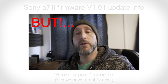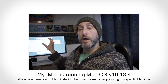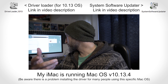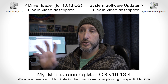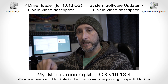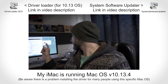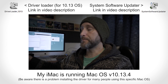A couple of things you should know if you're running a Mac like I am — I'm running the latest version of High Sierra. First of all, there's a driver loader which you need to install just to actually install the system software updater to be able to do the process of updating your camera. That didn't actually work for me because there's a bug apparently in the latest version of Mac OS where the security settings won't allow you to load this driver — even though you're clicking allow — so you can't install the installer. If you're using 10.13.4, there's a good chance you can't get the software onto the camera.